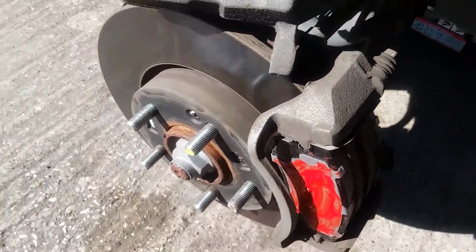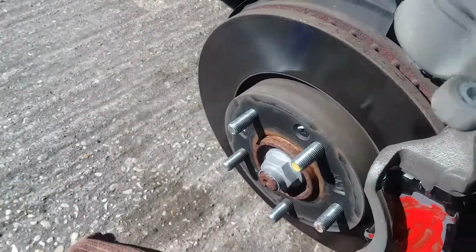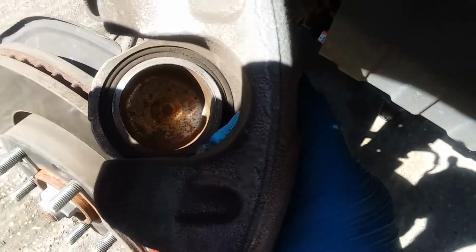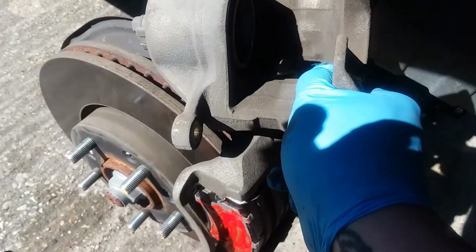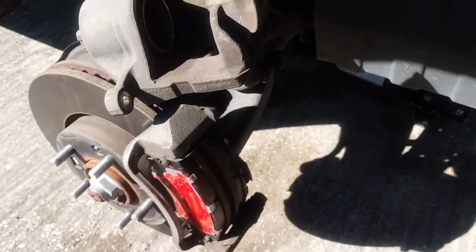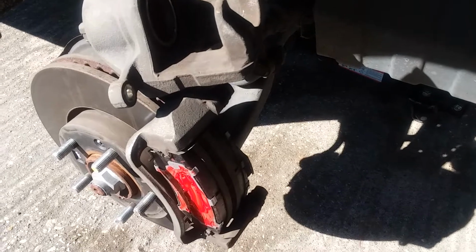And again, remember, like I said, look for your brake piston, caliper piston. As you can see, that one's hollow, so that's one that can be pushed down. If it's flat all the way in the front, right here, that whole surface is flat with two notches, you know that it does not press down, it twists down. So that's pretty much brake pads on any vehicle, not just a 2013 Kia Soul, but any vehicle that you might have. Simple as that.